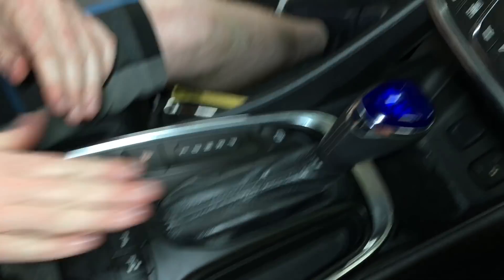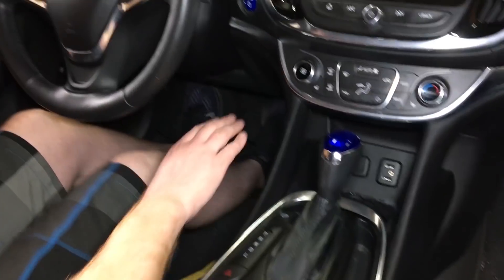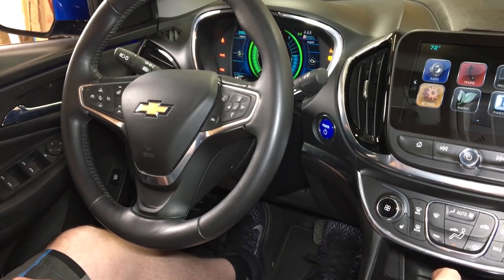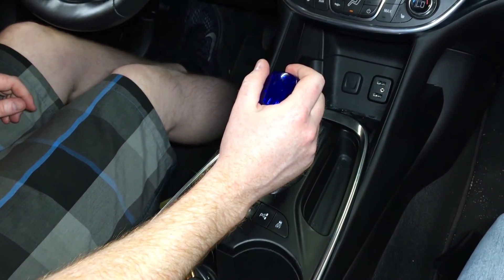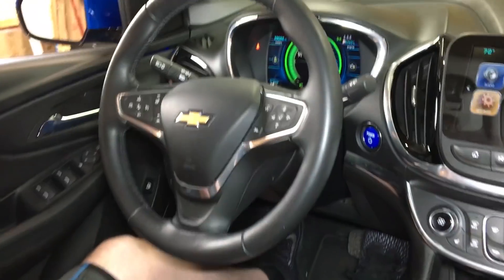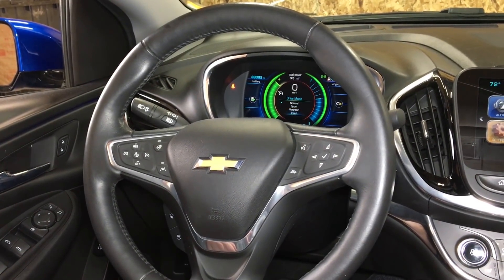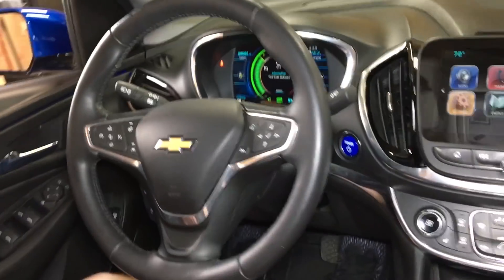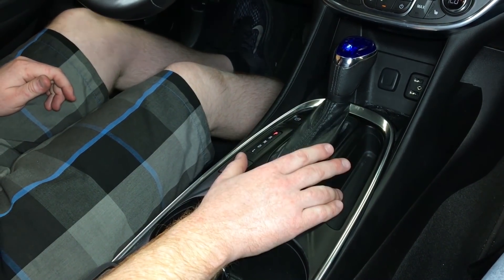And that's it. Let's try and put it in gear. Let's give it a start — put it on the brake and start it up. Reverse. Okay. Drive. Let's go all the way back to L — let's go through all the gears. It's actually a lot smoother than the old one. Let's just make sure everything works. Let's go through the modes. And let's try and set the parking brake — there we go. That's everything we unplugged and it all works. Hopefully that fixes my shift to park issue. If not, I'll update you if it comes back. If you have any questions, just leave a comment below.